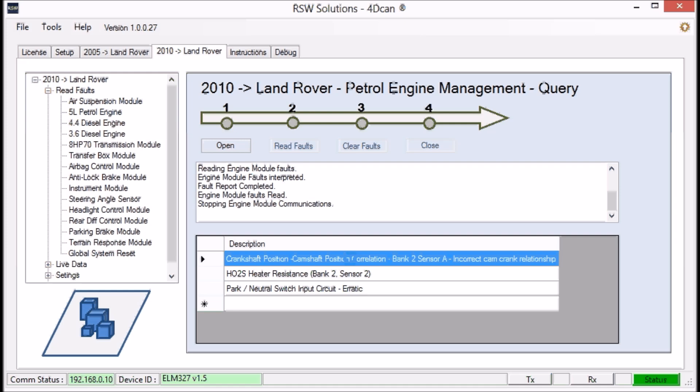This is going to require repair, and the repair has gotten more expensive. Not only is it a repair on the timing chain guides, it's also going to require resetting or revalidating the physical timing in the engine. We'll have to double-check that the timing chain hasn't skipped a tooth and reset the timing on the actual relationship between the cam and the crank — that's an extra roughly eight hours of labor. Hopefully this will help you be aware of the issue that all of these Ford 5-liter motors have, and we can investigate steps using your own eyes and ears and the 4D CAN software tool to diagnose the issue. Thanks for watching.